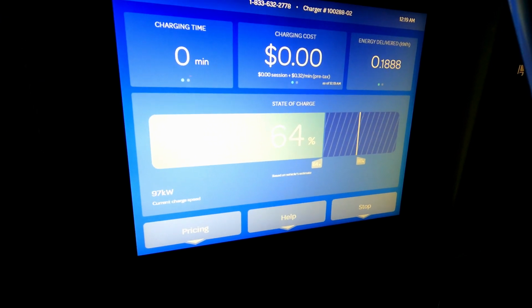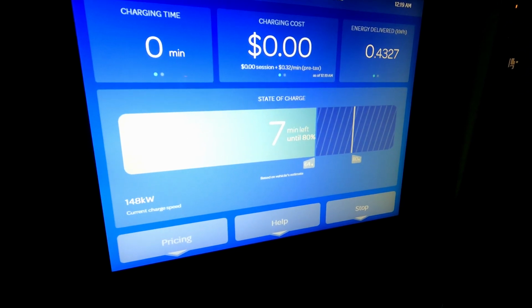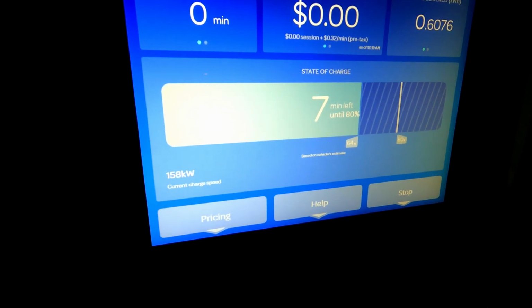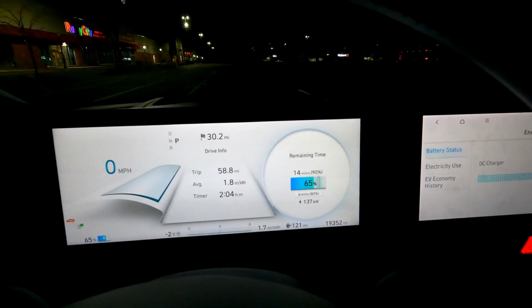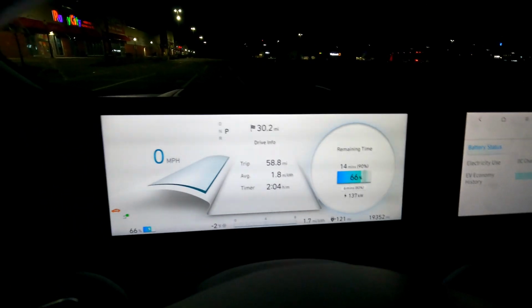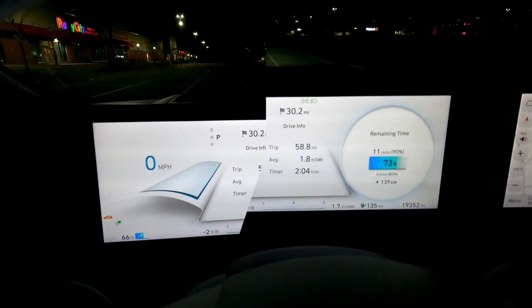But this should be good temperatures, and aside from the slightly higher states of charge, we should get everything. Okay, so not perfect, certainly not the 240 that it's capable of in ideal temperatures, but given the high state of charge and given the temperature, I think we can accept 161 peak, a healthy 140 kilowatts.